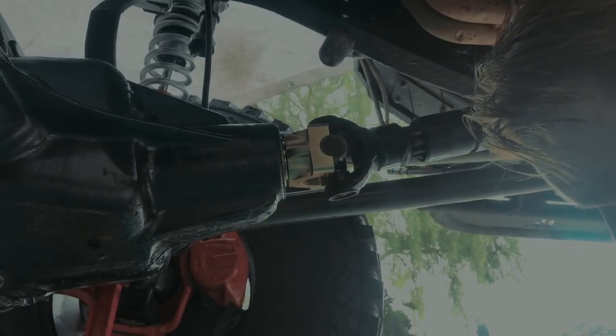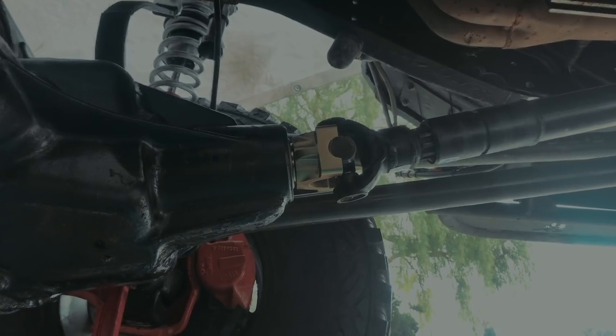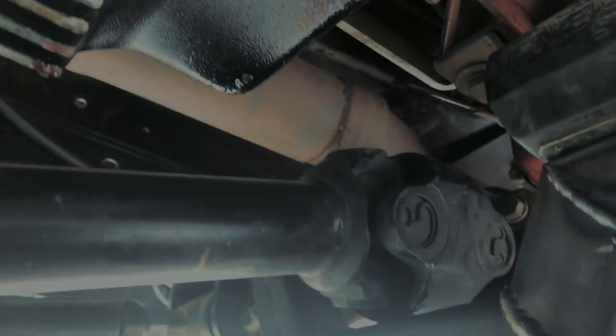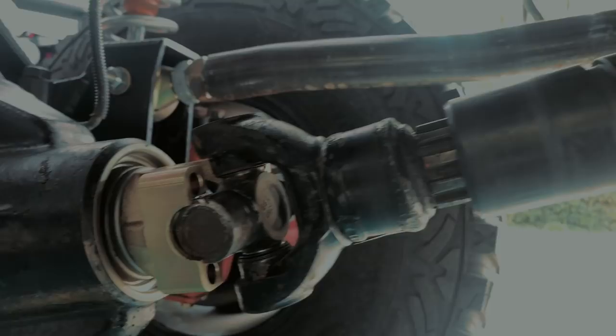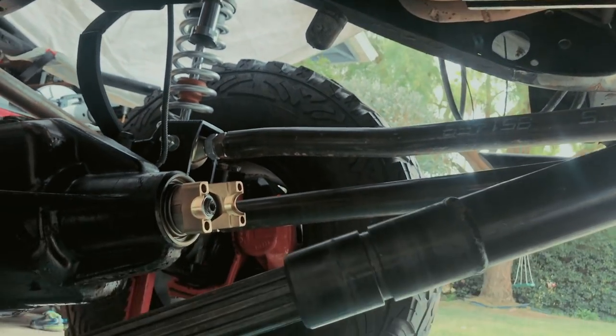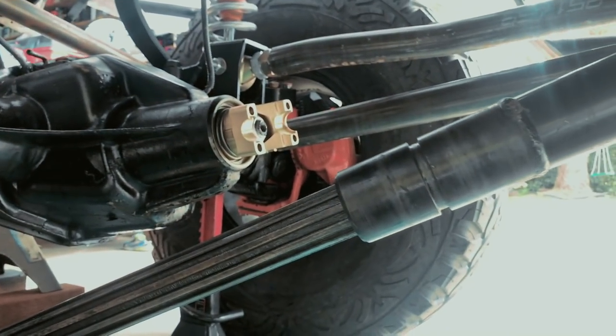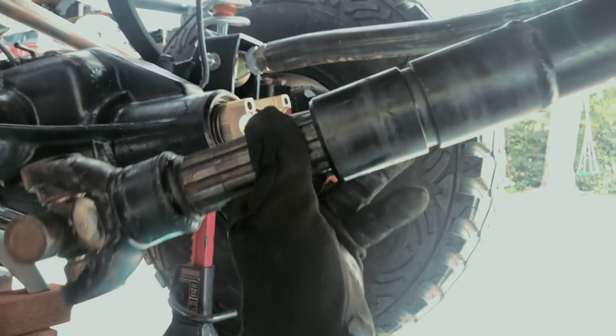Hey, those of you on my channel have been around long enough have probably seen me breaking all those drive shafts. So let's just take a quick look at what I did to solve this problem. Big universal up top, or constant velocity, and then down low, I swapped to putting the splines on the yoke instead of the main shaft. So I've got a splined yoke down here. Look at that. Now, I'm not expecting to get that much droop, but what this does is it just gives me tons and tons of surface area to reduce torque shear.